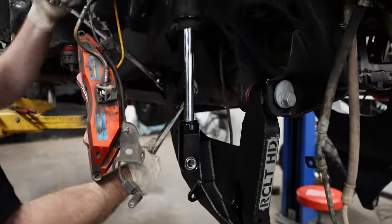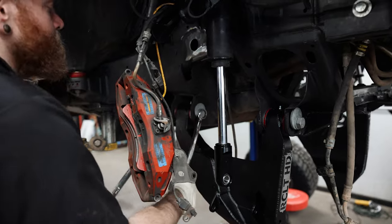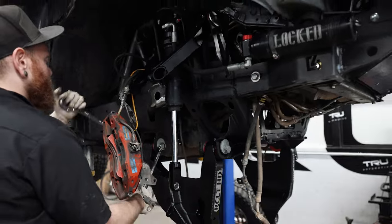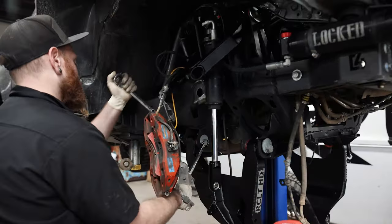And now he's gonna tighten down these cam bolts, front and rear, and then obviously not torque because you have to align it and everything after everything gets cycled, but then we can put in spindles and then we can cycle the shock and see where those bump stops need to actually go.